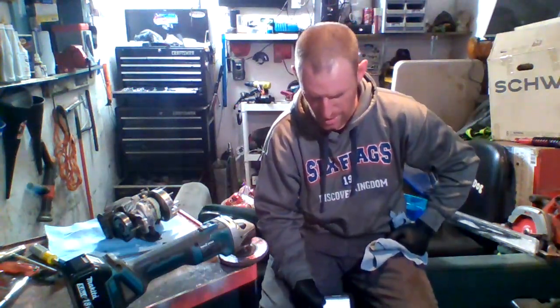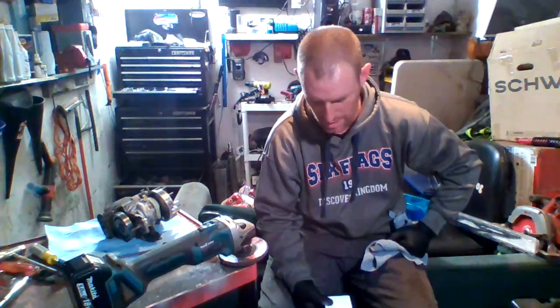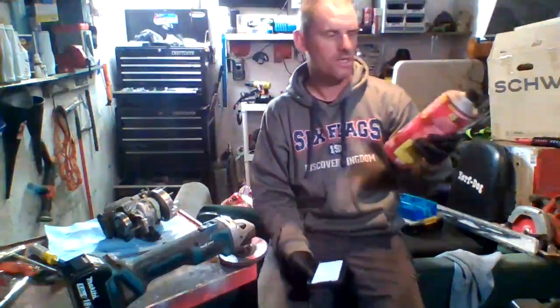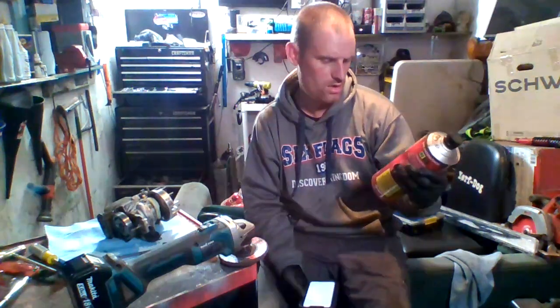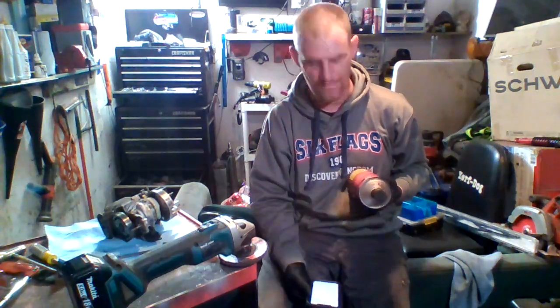And then they were discontinued in 1977. It's only a single cylinder, mixed gas. So, you know, I use TruFuel, the 50-to-1 mix. That's the only thing I run in these things. They have other types out there you can use. This is ethanol free, 92 octane. So this stuff's good stuff.